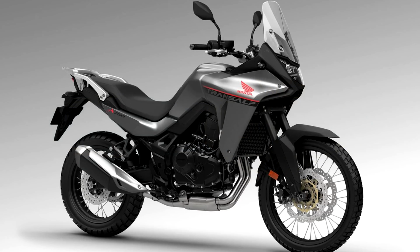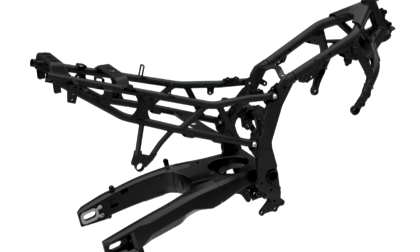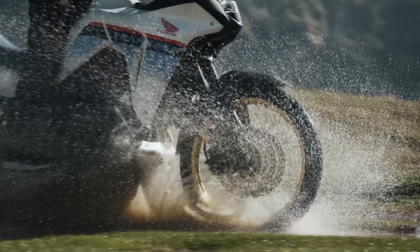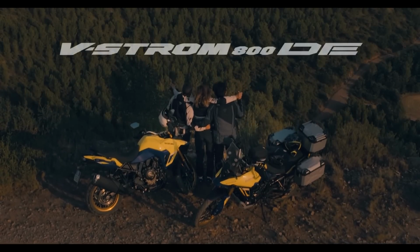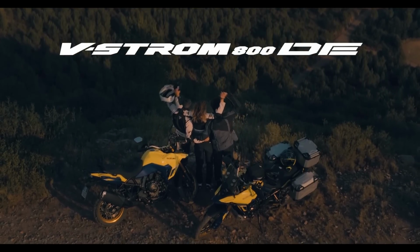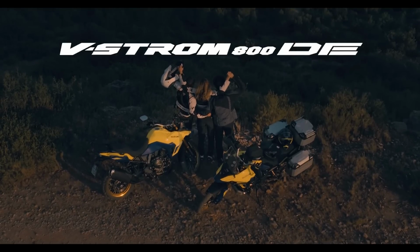Finally, if this comparo is about off-road cred, then the fact that the Suzuki V-Strom subframe is bolted on rather than welded on like the Transalp's means that in an off-road tumble, if damaged, the subframe can be replaced on the Suzuki rather than writing the Honda off. This will be a big miss for any potential dirt-orientated adventure riders out there who are leaning towards the Transalp.